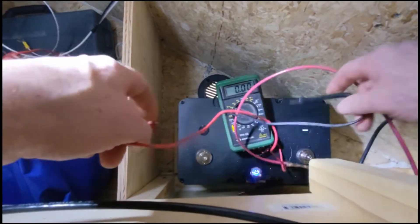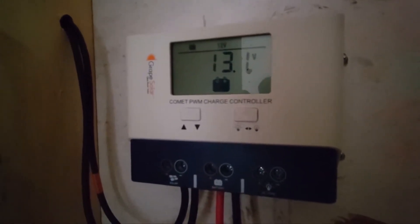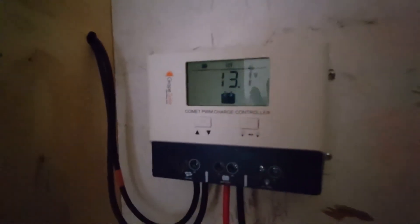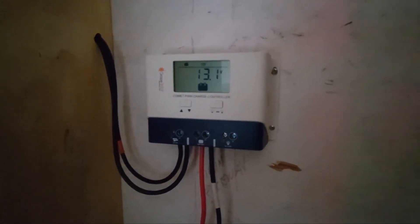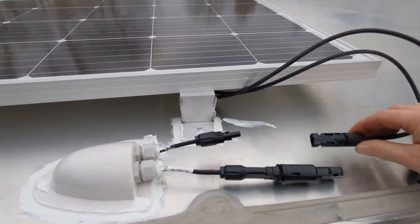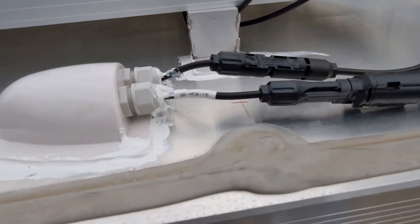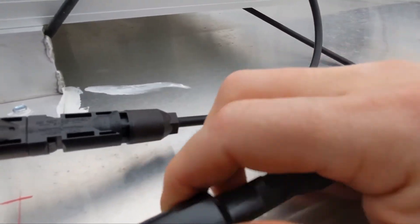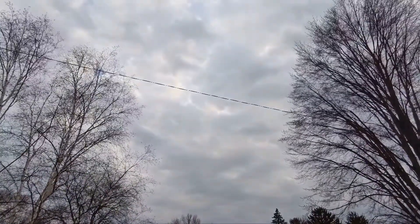Next step is to connect the battery and then we'll see what the solar panels do. Back looking at the charge controller — it's confirming 13 volts, monitoring what the battery is doing. It says 12 volt mode, 13.1 — and that's without the solar panels hooked up yet, that panel's still unplugged up top. So I'm gonna go change that right now. Back up top — these plugs are pretty much idiot proof. That one can only go in one way and snaps. The next one goes in and snaps in there.